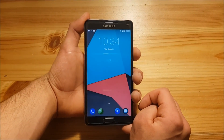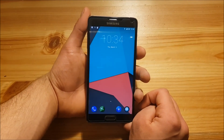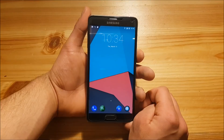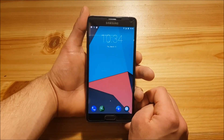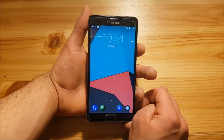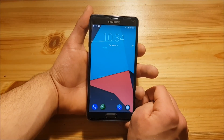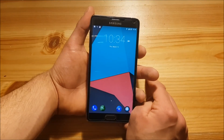Let's start with the first part of this video: the installation. To install this Android Oreo ROM on your Samsung Galaxy Note 4 there are a couple of things which you need to do first. The first thing is TWRP. You need to install TWRP on your Samsung Galaxy Note 4. If you don't know how to do that or haven't done that already you can watch some other videos on YouTube showing how to install TWRP on your Samsung Galaxy Note 4. You can't install this ROM without TWRP and you don't need root.